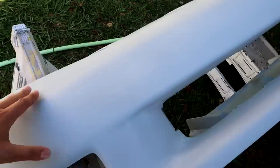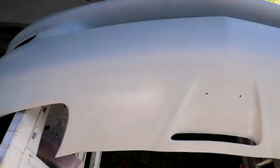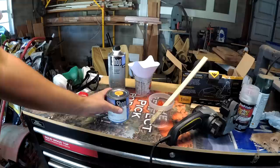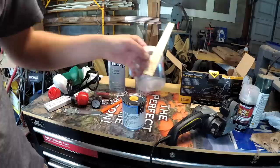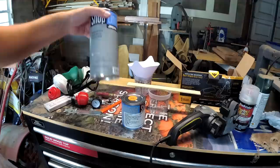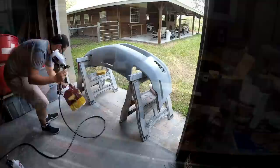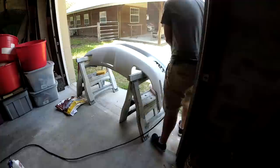It's the next day. I went ahead and sanded this down with 800 grit, and what we have is a very smooth, completely primered bumper. I'm going to mix our base coat and put it in the $60-ish dollar spray gun — the professional Harbor Freight spray gun — and we are going to finally paint our Corvette bumper. Right here I have a pint of Shopline Plus PPG Arctic White paint. This is a 1 to 1 ratio — one part paint to one part reducer. This pint of paint by itself was almost $50.